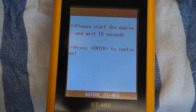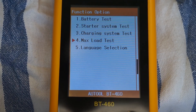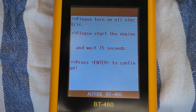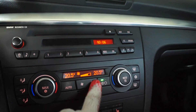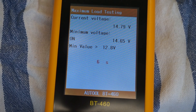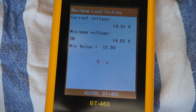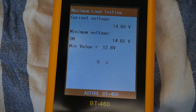Next is the charge test. With the device connected and your engine running you can see the fluctuations of the voltage, and it should stay within a certain range indicating that your alternator is working correctly. Next is the max load test — basically the same, but you should also turn on all of the electrical systems in your car: windscreen blower, screen defrost, fog lights, and so on. This helps you detect if your charging system can handle the additional drain, and your voltage should remain between certain values and not drop below.